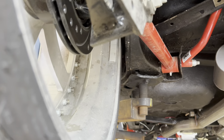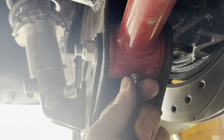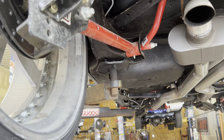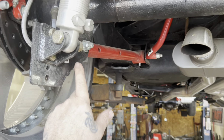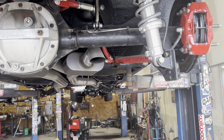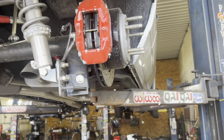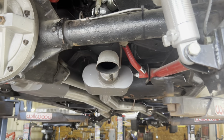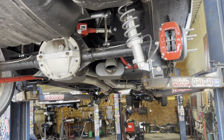These lowers are not double adjustable — I don't like that. There's a Zerk fitting with absolutely no grease on these bushings. With big rims when you got a wheel that fat and you need room, and you got bushings — there's one, two, three, four, five, six — if each of those moves an eighth to a quarter of an inch, the rear end is moving side to side. If your tire or rim clearance is tight, it's gonna rub. There's even bushings on the other side, so that's eight total.